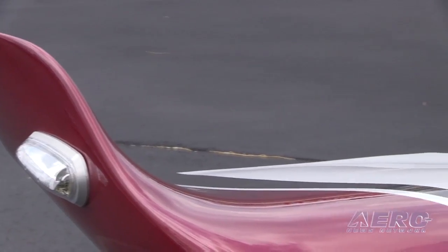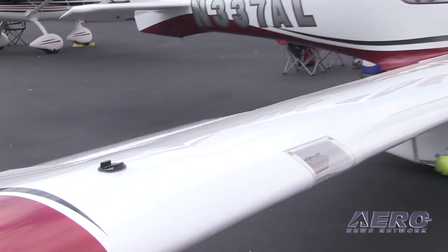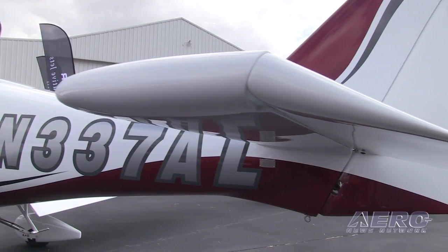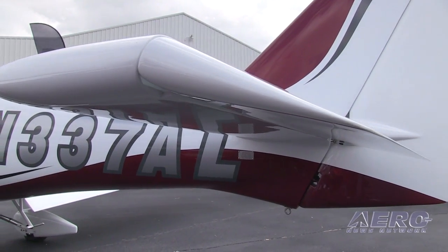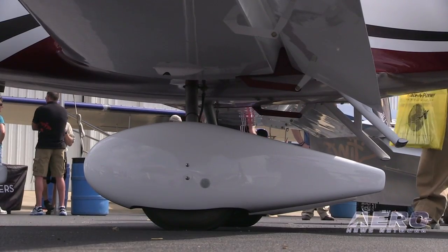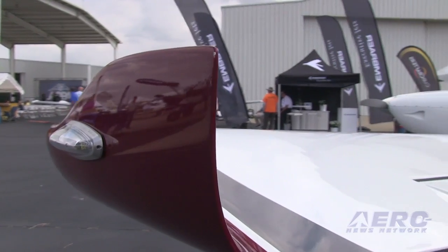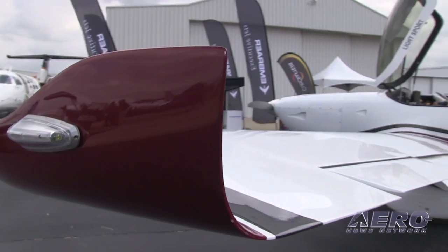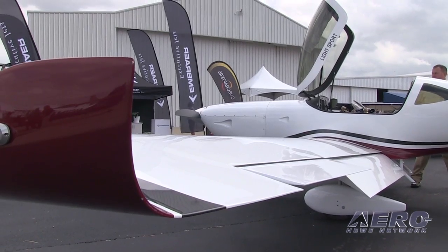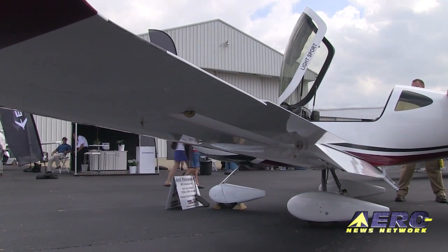What kind of performance are you boasting for the airplane? In kit version, with all the speed fairings and a different prop, we're looking at about 130 knots cruise at 2,850 RPM, which is around 70% power for the Jabiru. In light sport configuration, we remove the go-fast stuff, dirty up the gear legs, and put a different prop on it to slow it down to 120 knots. The airplane is otherwise exactly the same. The longer wingtips are needed for the stall speed in the clean stall configuration for light sport, though most kit builders put them on anyway.